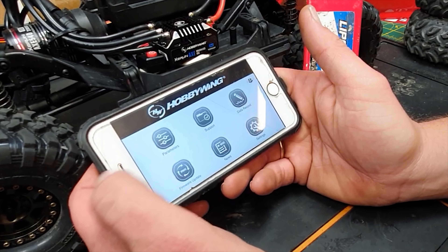The way it's set up - which is how it comes out of the box - when you go forward and let go, drag brakes automatically come on, but you can go instantly into reverse and forward again. When you let go it automatically brakes. Looking at the drag brakes on the hill - it stops and holds there perfectly. You can adjust how much drag brake you want in the parameters - currently set to around 60-65, and Steve says you can go all the way up to 200 where you basically can't move it.